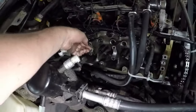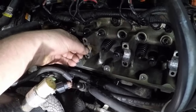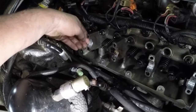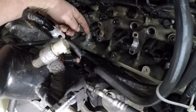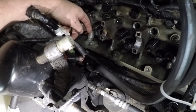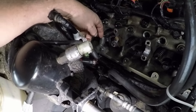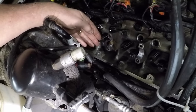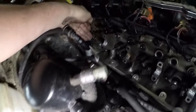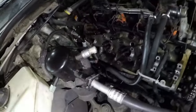And when I pulled it off and I saw, I mean, this is some heavy metal in here. Look at that. That's from the upper half. It's just welded itself to the head. So obviously the cam was working its way out, and that's why there was more and more play between the rocker. Well, they call these followers, but generally we just call them rockers. So it was just too much gap. Like I say, the cam was slowly working its way up, and this was just building up, so the cam kept coming up and up, and that's why there's such a gap.